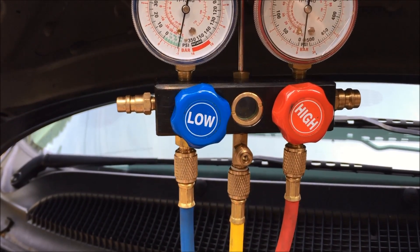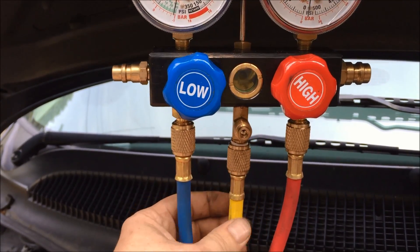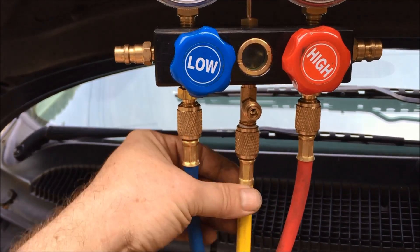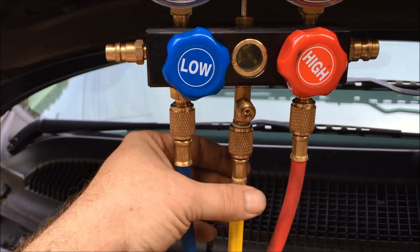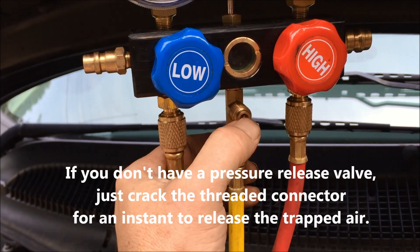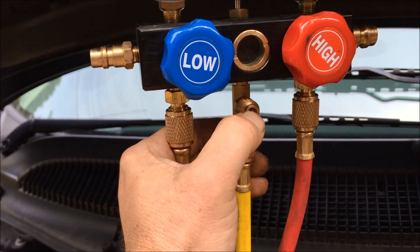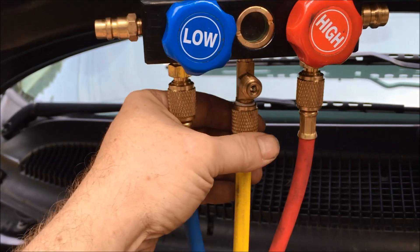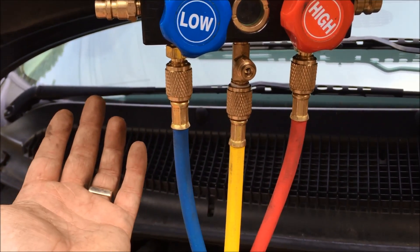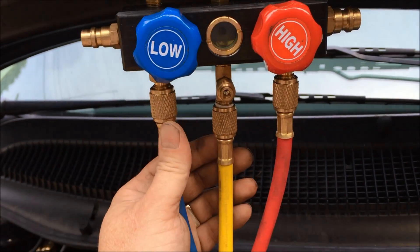What I'm going to do now is uncouple the vacuum pump and start to put the refrigerant cans onto it. When I do that, the refrigerant is going to fill up the hose with whatever pressure is in the can, but there's going to be a lot of air it's pushing up into this part and we don't want air to flow into the AC system. There's a little Schrader valve up here — a little pin like a bicycle valve. I depress that for a couple of seconds and the force of the can pressure pushes the air out through this little valve. When I hear or smell a little refrigerant, the line is completely full of refrigerant. The little bit of refrigerant that escapes into the atmosphere — there's not much you can do about that. Your goal is to have it be as little as possible. Wear gloves, wear eyeglasses, and turn this off to the side — don't let any of that refrigerant get near any part of your face.